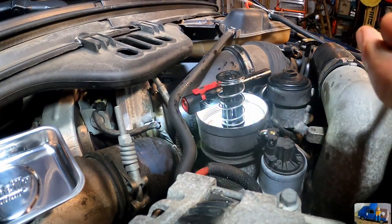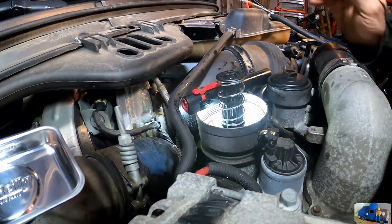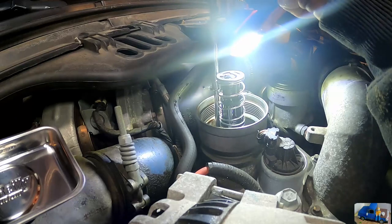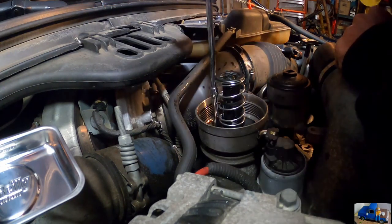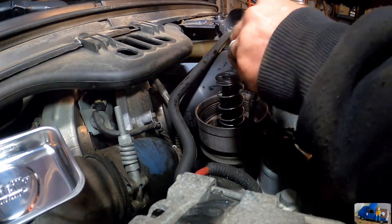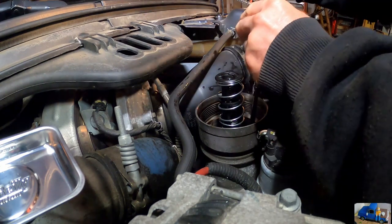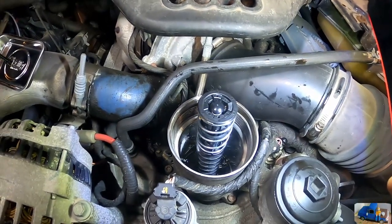So I put a screw on the end of the socket and put a little tape on it, hopefully it stays on there, so we can get it started without cross-threading it. I'm going to try the torque wrench just to see how it feels, and if it feels like it's gone too far, we're just going to forget it. That worked pretty good. New bolt, torque to 44. New standpipe is installed — it was actually really easy, kind of ridiculously easy. I don't know why I waited this long. I used it broken for so long that it was just normal. That's fixed — I'm happy.